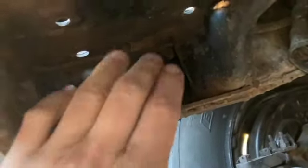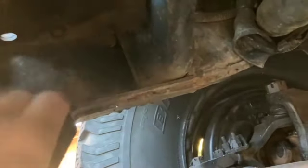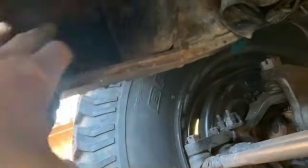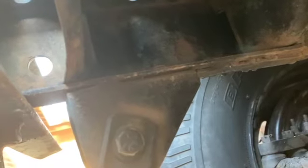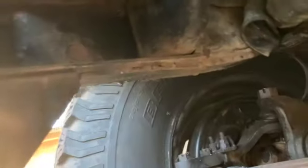This is the shape of a C. I like this better with just some plates in here to reinforce stuff. There are certain places you need bracing. But here, you can get a nut in here, you can stick a bolt through here, you can drill through this. This is so much easier to work with on the trail. These are riveted on. If something happened out on the trail, you could easily cut these off and get a bolt in there. Everything is a lot easier to work on.